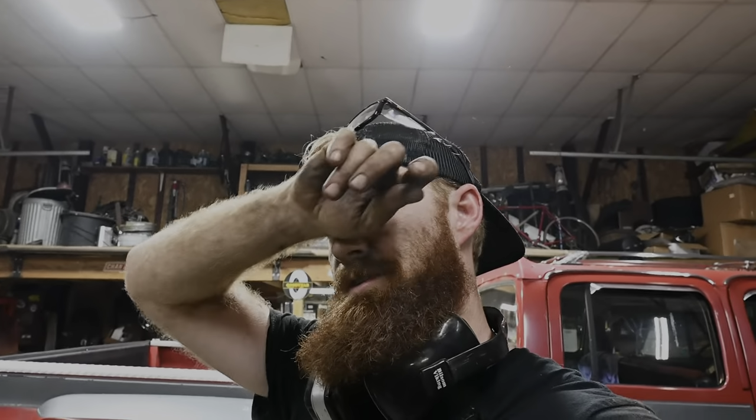Alrighty, so about the last 30 minutes, been getting acquainted to my air hammer here. I got a chisel bit on the end of this thing, and I went on the inside and knocked all those rivets off. Now, you do have to have a pretty strong air hammer to do that, but I just kind of worked it back and forth on those rivets.